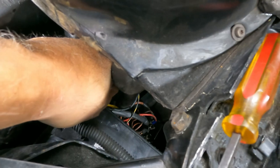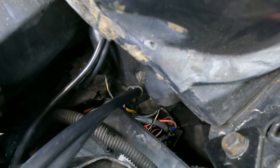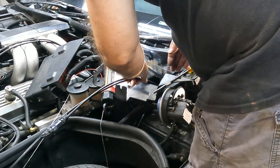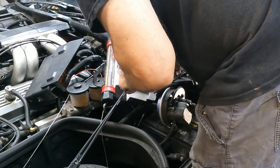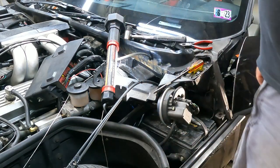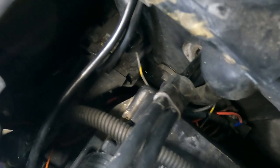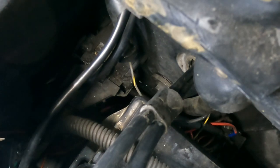There's the grommet — hopefully you guys can see that. You want to get that in there good because you want a watertight seal. One thing I probably should have done is grease this up with some silicone lube. I just made a really big oops — I tore the rubber grommet. Yeah, that tears easily. So I'm going to try and pull it through with a pair of needle nose and get the grommet on there, then get the plastic piece in the back, and then I'll have to just silicone it. Don't pull hard on that — hopefully you learn from my mistake.